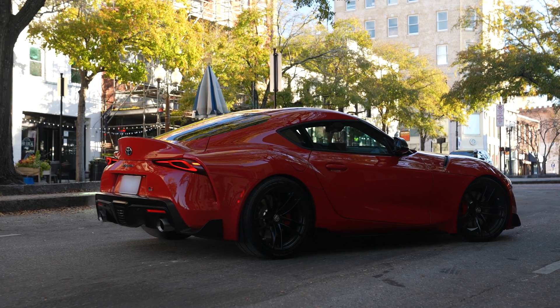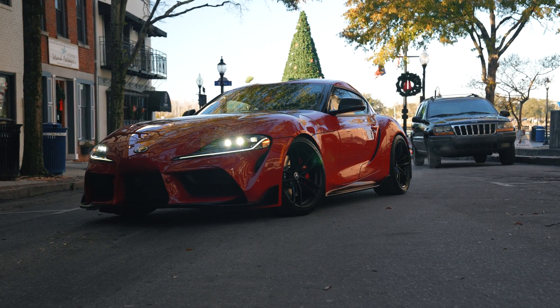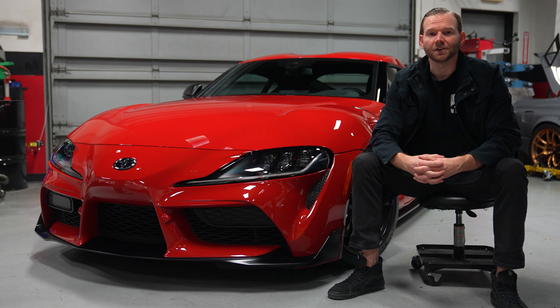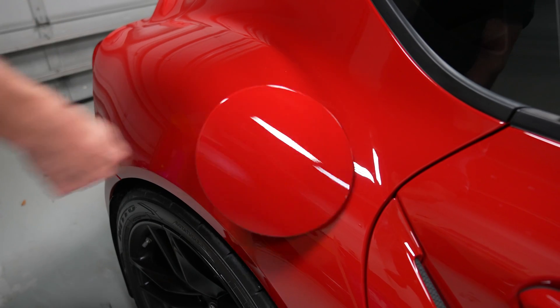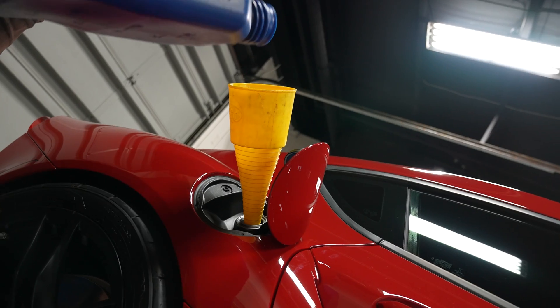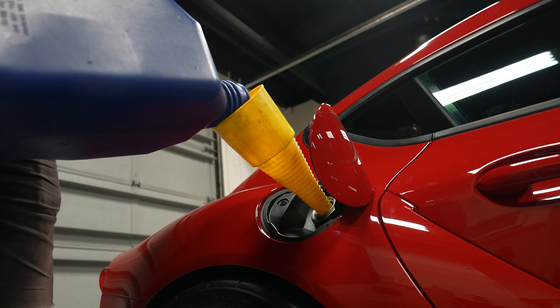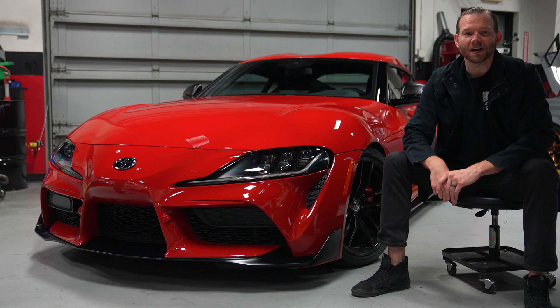Next, we need to determine the content of our ethanol fuel. This varies if you're getting ethanol from the pump, but in our case we're using VP Racing X98, which is 98% ethanol. That's all the information we need. Using any of the calculators returned from a Google search, we punch in this data and figure out how much ethanol fuel we need to achieve our target 40% ethanol content. Calling our current fuel 14% to be safe at 6.75 gallons, it looks like we need three gallons of X98 to hit our target 40%. The fuel does need some time to mix, so let's go for a drive and monitor the ethanol content.